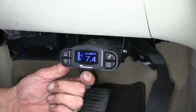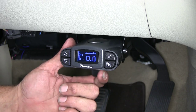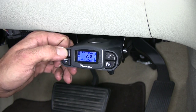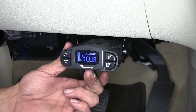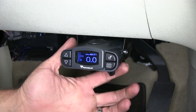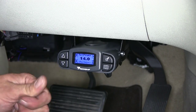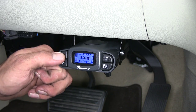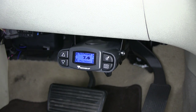On the bottom we've got a manual override lever. This is going to allow us to manually apply our trailer brakes in the event that we need to. No matter where we've got our output set and we reach down in a panic situation, it's only going to go up to that number for us. Here we've got our power setting adjustment. We can bring that down or up just depending on the weight of our trailer and how much braking force we're going to need.